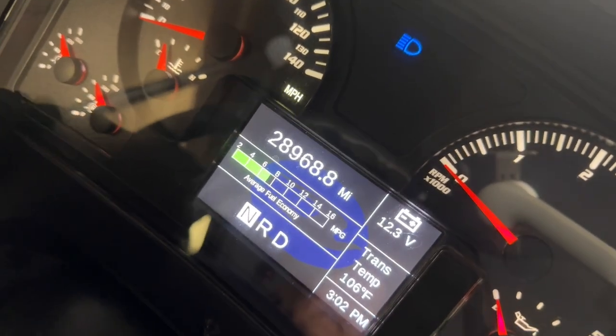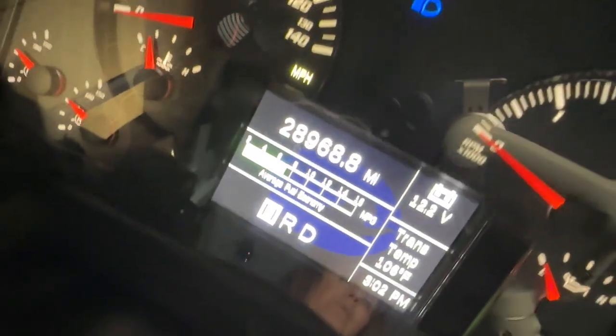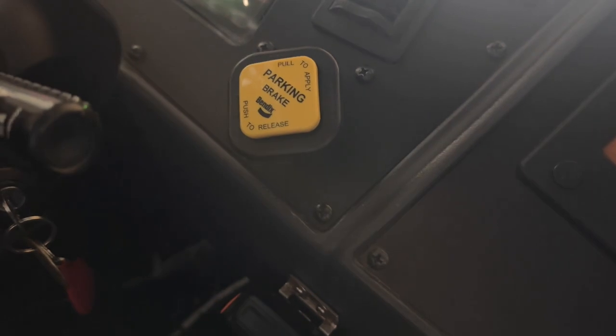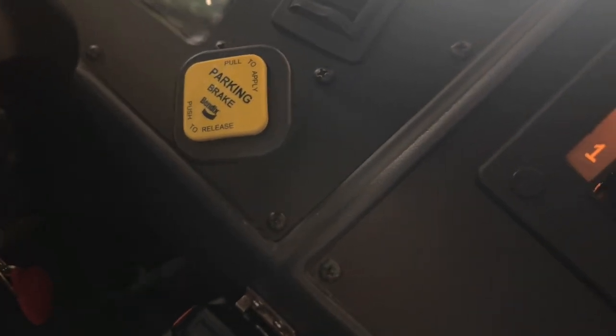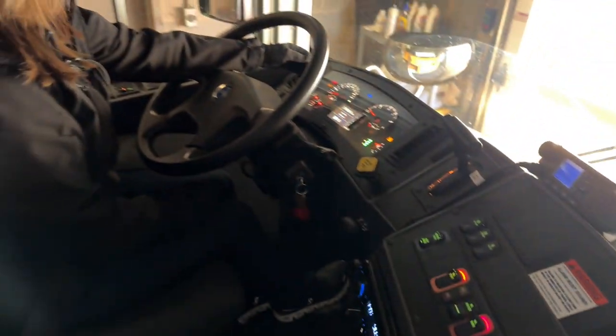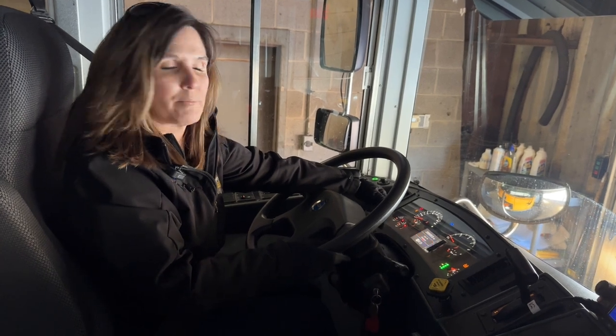If they say move on, start fanning your service brake to release the air from the tanks. Press on the service brake until above 55 — your light and buzzer will come on. And between 20 and 40, your parking brake will set itself. Continue fanning the brake until that happens. Our parking brake popped and our air pressure lights go on, so we know that all of our emergency brake features are working properly.